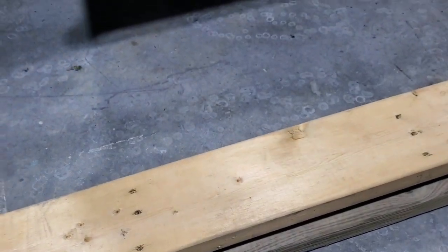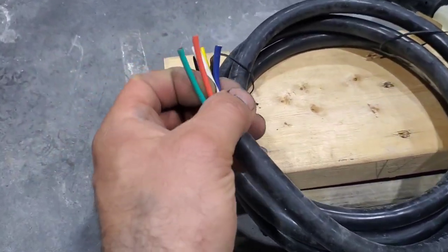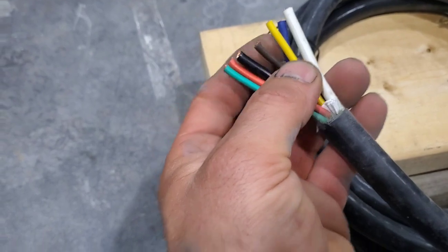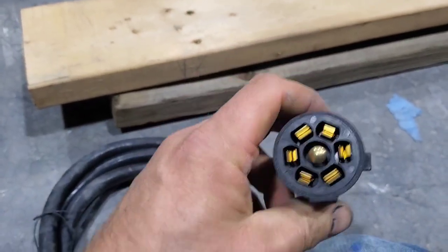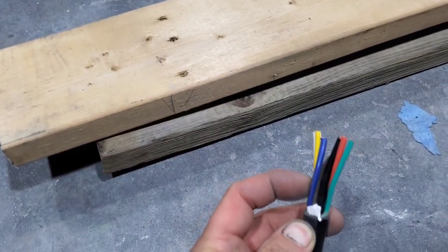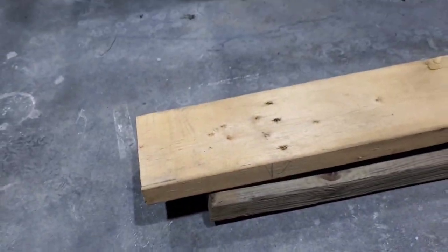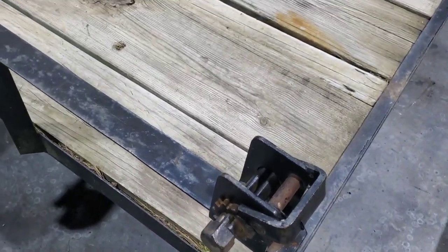They were saying that the color codes on these plugs can be just whatever random things, so I am going to use a voltmeter set to continuity and I can pin this and figure out exactly which one goes where. I can cut the insulation back and label each one of these wires individually on where they need to be plugged into on the trailer. So I'm gonna go through the whole trailer and fix all of this stuff.